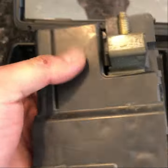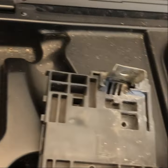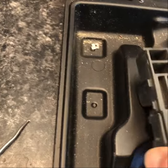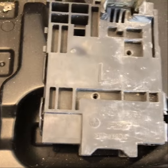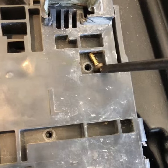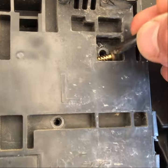Remember what I said about this not being advisable? Well, I wanted to explain that, but I kind of forgot what I was talking about. So, if this fuse doesn't blow, and you end up getting a short, or your car battery ends up getting charged backwards again, it just happens sometimes. Then this could potentially not work as a fuse, which means you then have to deal with whatever else blows next. That could be your alternator, that could be your battery catching on fire, and I heard those aren't fun. No, not fun at all.